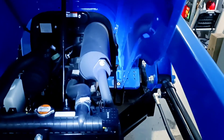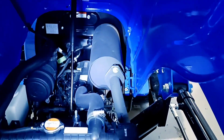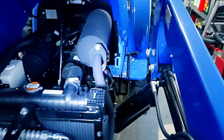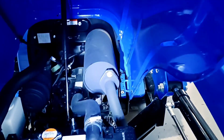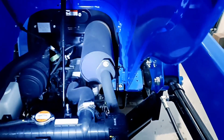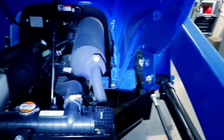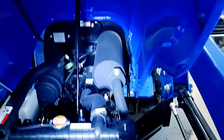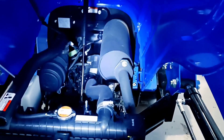There are different ways to accomplish that. Some companies use diesel exhaust fluid, with an injector on your exhaust pipe that injects DEF into the exhaust, which then runs into a very fancy catalytic converter called an SCR - selective catalytic reduction. There are DPFs, SCRs, DOCs, and all these different acronyms you can go online and study, but there are different ways to skin the cat. Bottom line is they have to clean the exhaust before it exits the pipe, and that requires a lot of very expensive and complicated equipment.